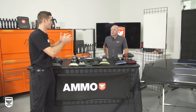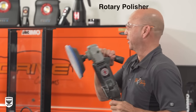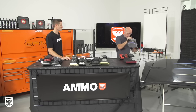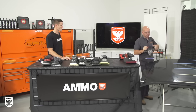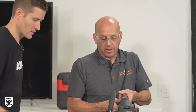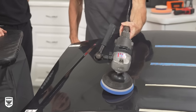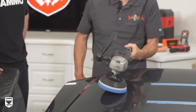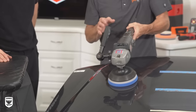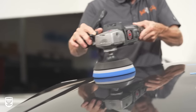Let's talk about the strengths and drawbacks of the rotary polisher. When you pick one up and hit the throttle, it feels really smooth. But when you put it on the paint, if you haven't used one before, you'll notice right away it pulls. On curved panels or if you tilt the machine, it will run away from you — it travels in a direction depending on how you steer it, just like a tire and wheel. It's not easy to control one-handed. There's a lot of torque and a lot of weight, so it's good to have a side handle.